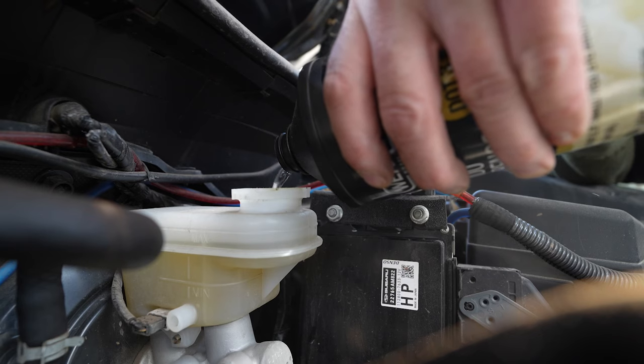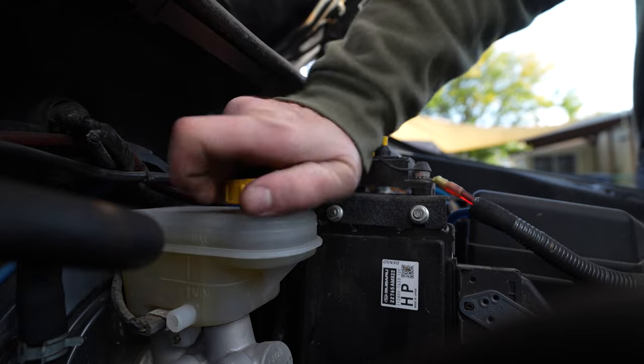Because we did bleed out some fluid, check to make sure your master cylinder fluid is full. If it's not, just top it off with the recommended brake fluid — in my case that's DOT 3 from a sealed container. Now we're changed out of our nasty coveralls into something worthy of sitting in this seat and we're about to test the brakes. Start the car first and pump the brakes — they will be soft and they're going to go down to the floor until you get enough fluid in and compress those calipers back up against the pads. Once you do that, it shouldn't take more than one to two pumps. Your brakes should go back to feeling normal. Mine feels great, so check.